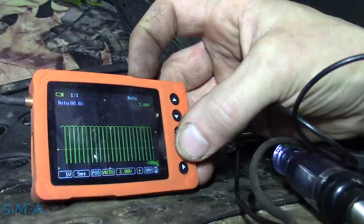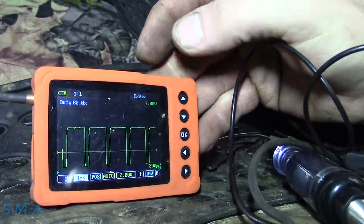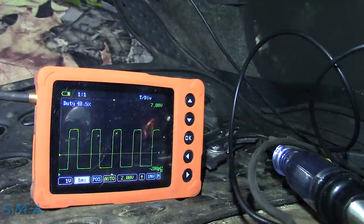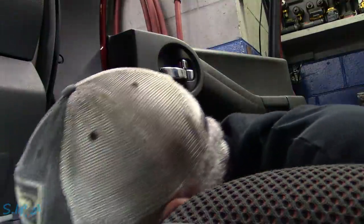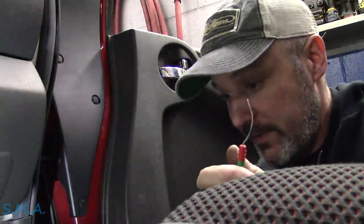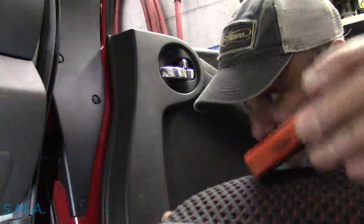So that was easy — we didn't even need a wiring diagram, I suppose they call them. It needs a blower resistor. A lot of these systems are kind of the same, folks. When you're looking at blower resistors and you see that you only have a couple wires, that's typically how they're controlled — usually a duty cycle control, at least in my small world, the cars that I work on.